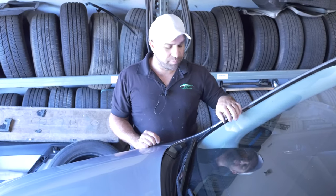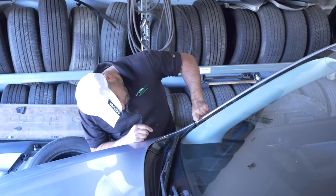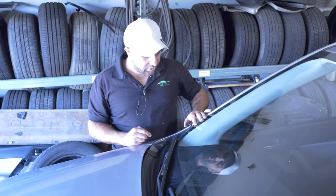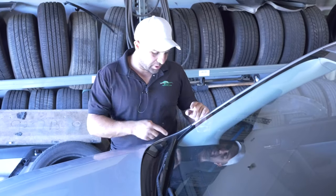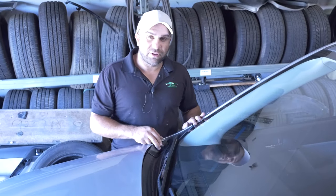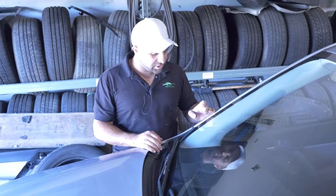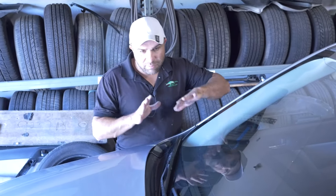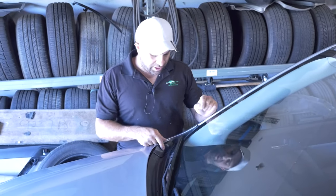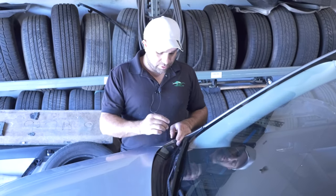I've had it to where someone's replaced the windshield and there's got to be like a good half-inch gap between the top of this pillar and the windshield. What happens is the glass guys will put the windshield in, they'll put a lot of glue and the glass will be even with the pillar — this piece is never going to go in. So just when you guys are replacing this, or glass guys are watching this, make sure you push the windshield down as much as possible, because I had a guy do one and I was pushing and pushing and I cracked the windshield putting in the molding.